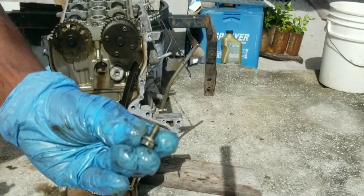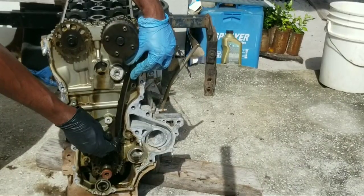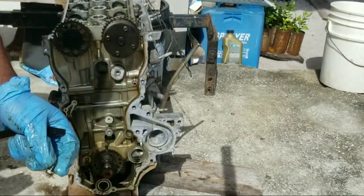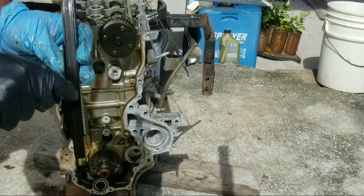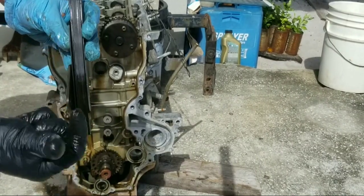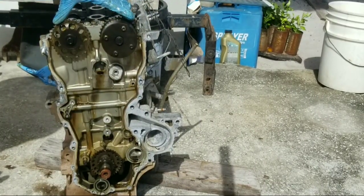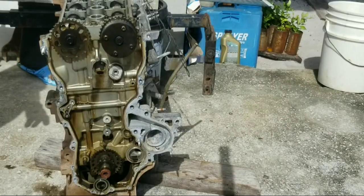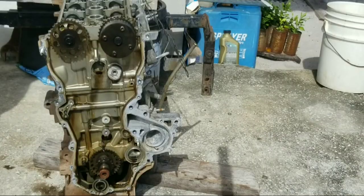See that nut? That's a short one. It's very important to remember where that bolt came from — sometimes you might be confused with a nut and bolt. This is a bolt. You want to do the same inspection here, just pass your finger sideways like that — you might need to take the glove off, but I can already tell this is in good condition based on the tightness of the timing chain when it was fully equipped. This brings us to the end of this part of the video. We are going to continue by taking the cylinder head off to get a look at the pistons.